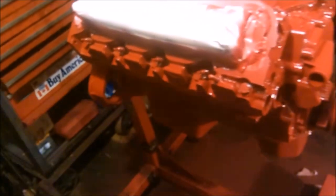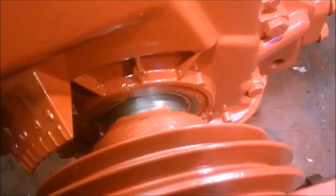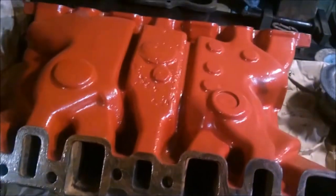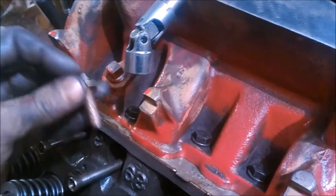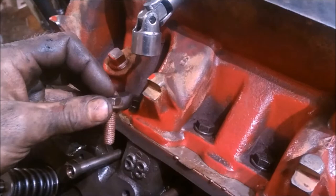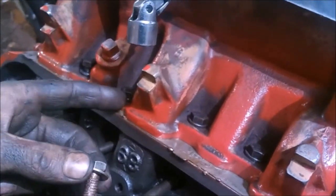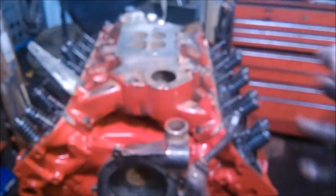Pull the plugs out too — keep it clean. After painting, the Vaseline just wipes right off; touch that up with a paint brush. Use our little swab to copper-coat both sides of the gaskets — thin layer, thin layer, thin layer. Wipe out the insides, bolt her down, and don't forget to put your mounting plate for your coil on there. The bolts are designed different sizes — these ones are smaller than these ones to make up for the obvious difference in the bracket. Torqued, re-torqued, tapped on all the heads.